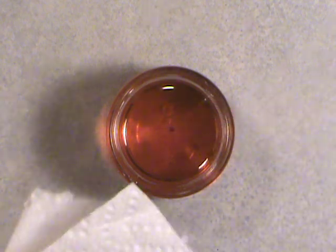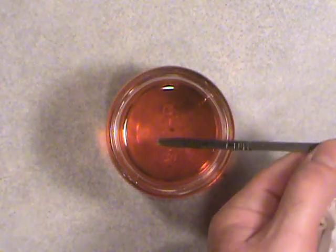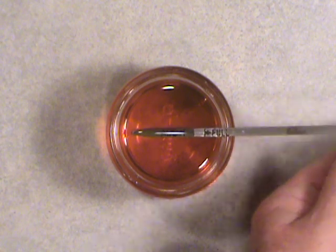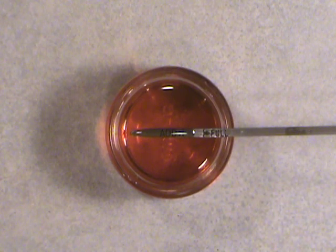And then I could even give you the halfway. We'll re-dip that, wipe it off, and re-dip it. Remember, this is gear oil, so it's sticking really well. Engine oil is thinner to begin with when it's at room temperature, but when your engine warms it up, it tends to thin out quite a bit. That's why I like to use a heavier oil, because I know when that engine heats it up and the oil's at operating temperature, fully warmed up, it's going to thin out. The synthetics generally do start with a lighter weight, a lot of them, and they can retain their oiling ability. They don't oxidize or break down like the conventional oils, apparently.